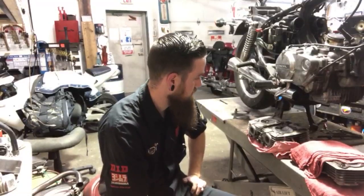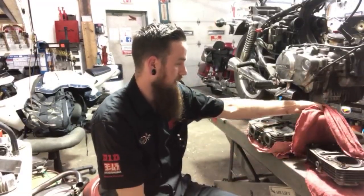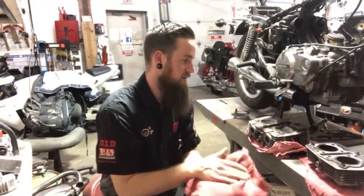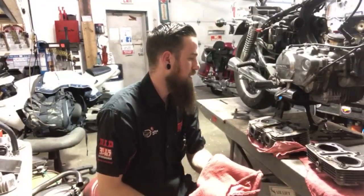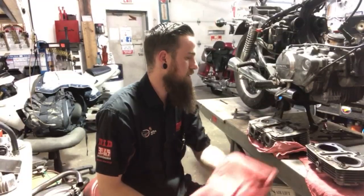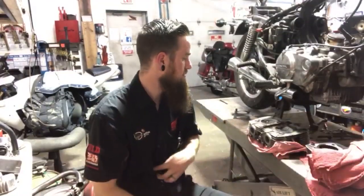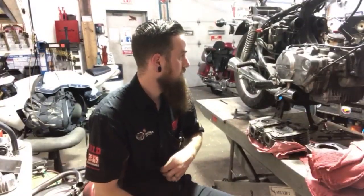I was hoping for something better, to be honest with you. Not that bad. I just, like, his 400A had the same problem. Had no compression on the left cylinder. And the piston was worn, and that's fine. I can replace the piston, hone the cylinder, boom, but this cylinder is toast. And there's probably metal in his oil pump and all that stuff.